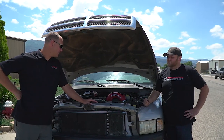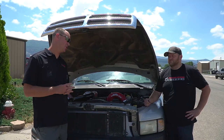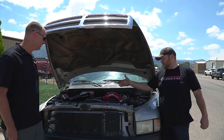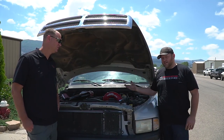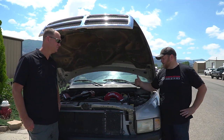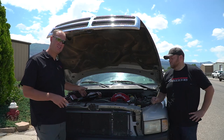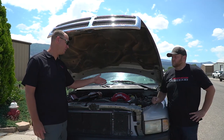For fueling, we got our budget builder 7x12 injectors — that's a pretty big injector for towing, which is why we're excited to test this. He also added some big air. This is our ultimate towing compound kit for the 12 and 24 valve — the second gen towing kit which consists of a K27 and a BorgWarner S369. That should be enough air for this fuel, because even with these big injectors we still have a limiting factor, and that's the VP44.